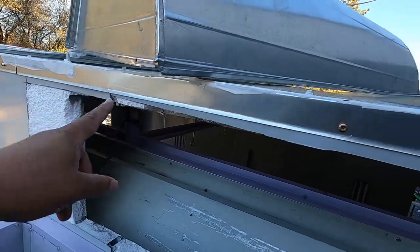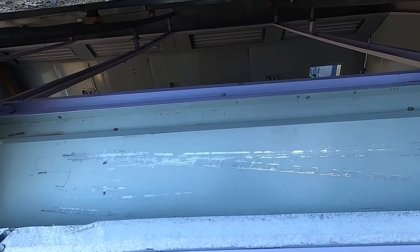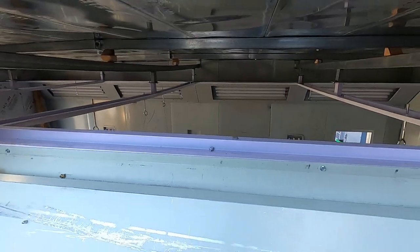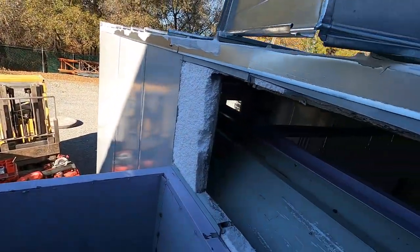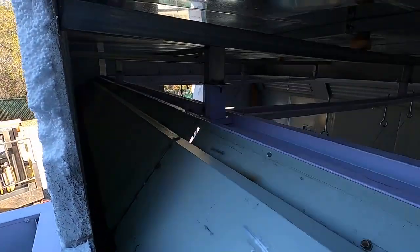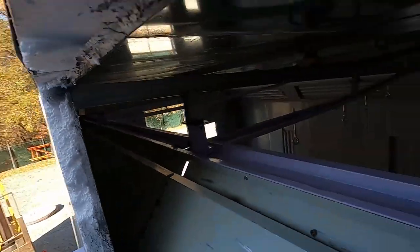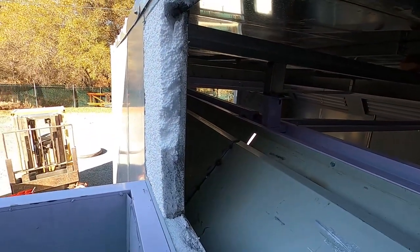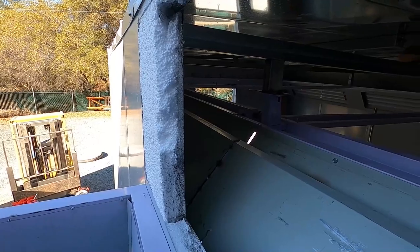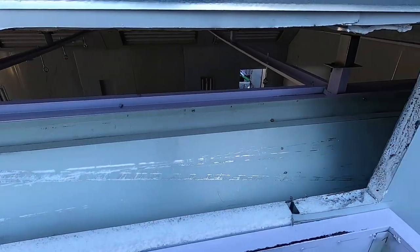I got the hole cut — you can see inside the booth. What I'm going to do is take some foil tape all around here, make sure there's no styrofoam or stuff like that coming loose during the paint job. This is where the filters are all going to go — all the air goes in right here and out right there. There's a cross brace going all the way across the booth sitting up against that wall, so it's a load-bearing area — that's why we left that little piece, but we'll be fine with the eight inches I had to leave.